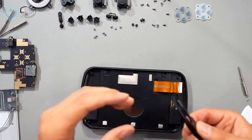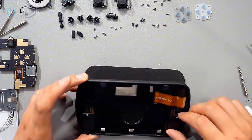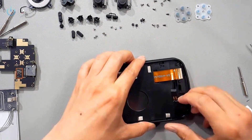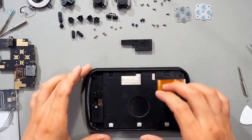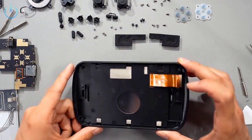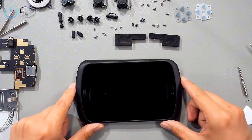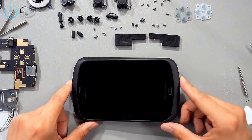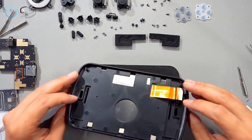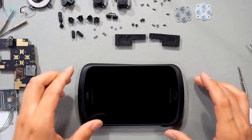This is the button on the front of the speaker. The buttons on both sides are exactly the same. This whole speaker unit is probably stuck on top — yes, this is a complete speaker module; it's snapped on top, not glued. As for the rest, it's just this screen here. There's only this one screen on top. This screen is laminated onto the A side, so I'm not going to take it apart, because I'm really worried I might break it and not be able to put it back together. Plus, the laminated area is pretty big — if it were just the screen in the middle I might have tried, but with both sides being this wide, there's glue all around.